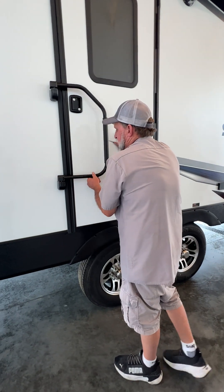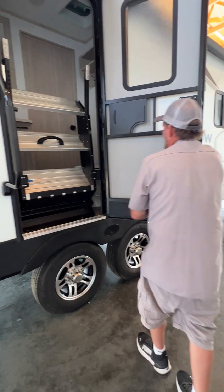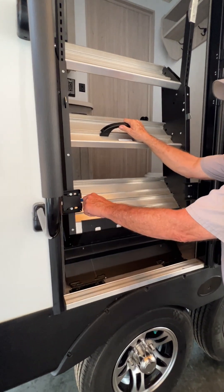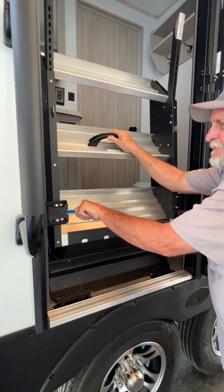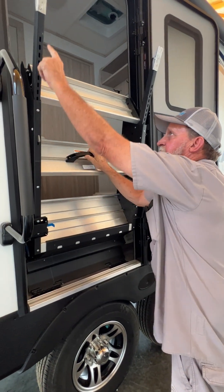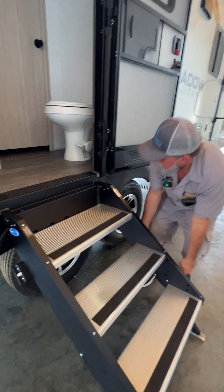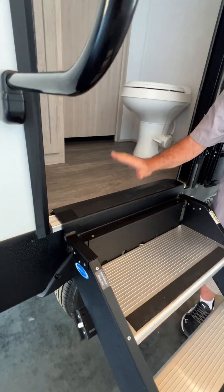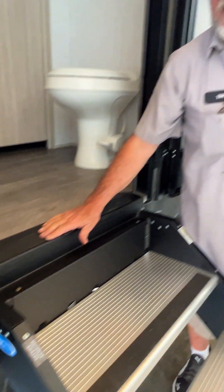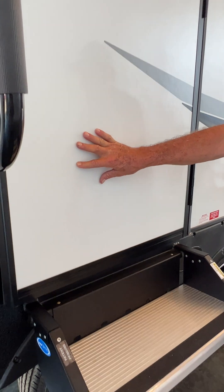The back door going into the bathroom area — we're going to lift up on it; it clicks into place. Open the door fully extended. A little blue handle on the left-hand side unfastens the steps from the door frame. As the steps come out, there's a little push button underneath each one of the legs with 15 to 18 slots on the legs. Once it comes out it lays down in position. The main thing is the steps have to lay flat in the threshold — push the buttons underneath the legs and adjust accordingly so the door comes over the top without scraping.